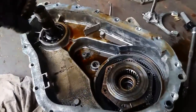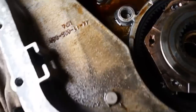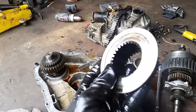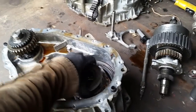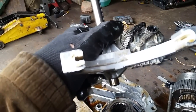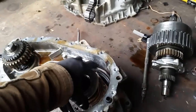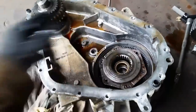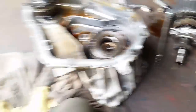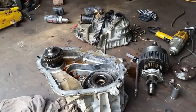That's how you put your chain in. This down here is okay — I checked everything. There are just some gears and some bearings, but it spins freely and feels really good. A lot of times they have trouble with these plastic tabs right here — they wear down so much that when this thing moves back and forth, there's so much play it doesn't allow it to go up and down to engage the in and out of four-wheel drive. That's why a lot of people either get stuck in four-wheel drive or it won't come out at all. But that's how this works — it lifts that up and down. So in a nutshell, that's it.